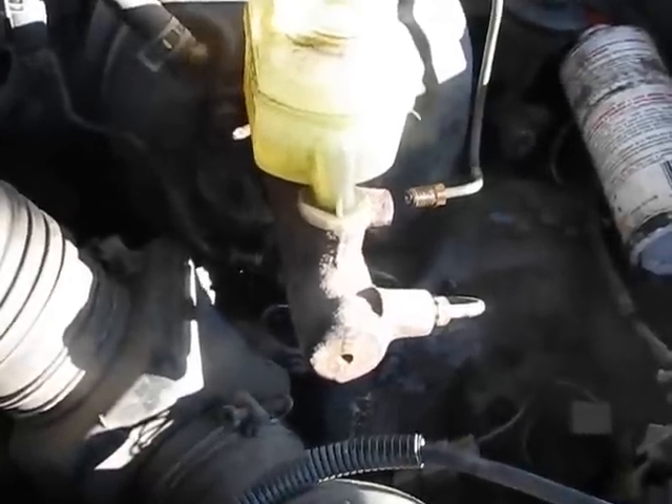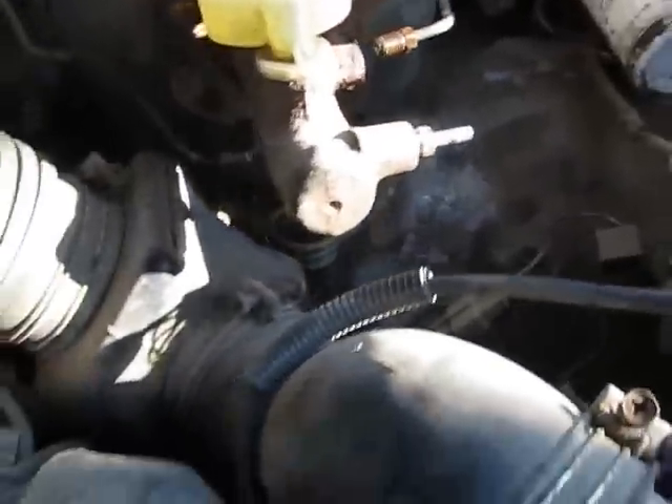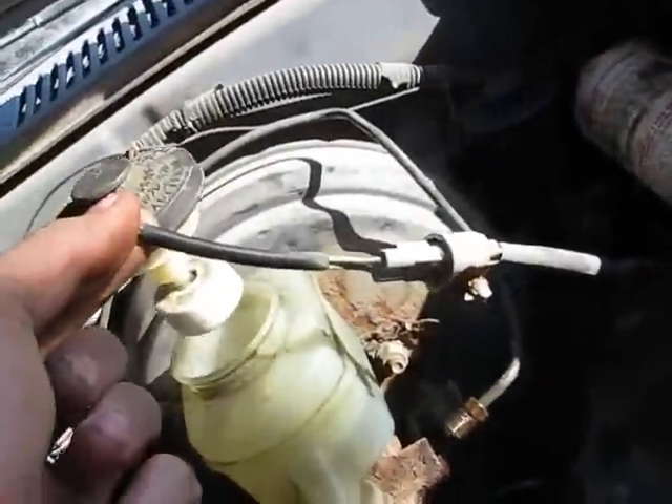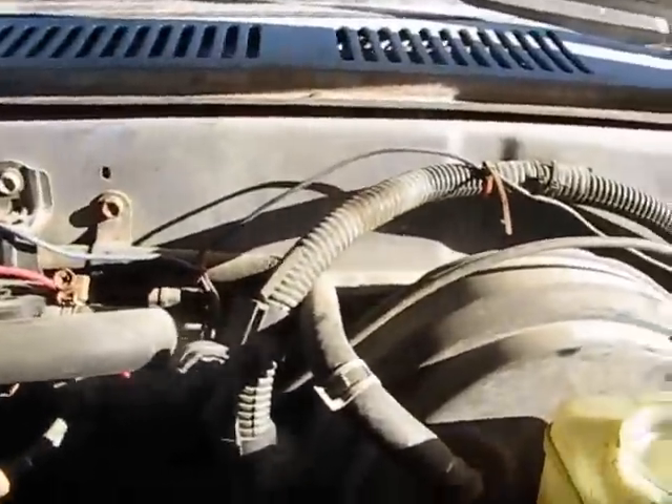With our brake lines disconnected, you might want to put down a rag so you don't get brake fluid on your paint. Grab your pair of pliers and take the vacuum booster hose off. Also the Toyota's got this low brake fluid sensor — take your pliers and pop the little tab out of the hole, set that off to the side somewhere where it's not going to get dirty, and then just give that a little yank.